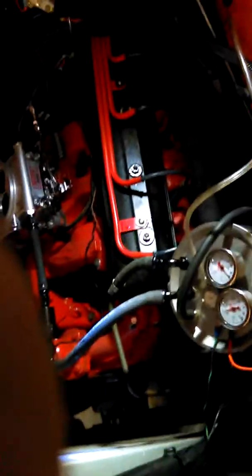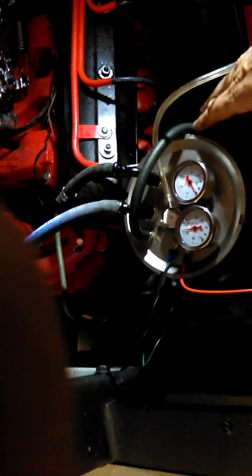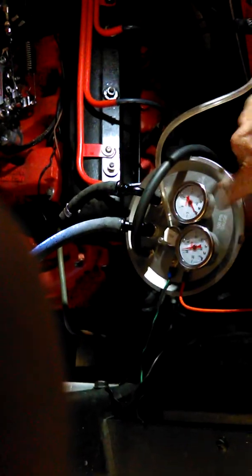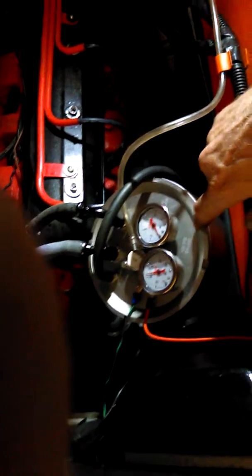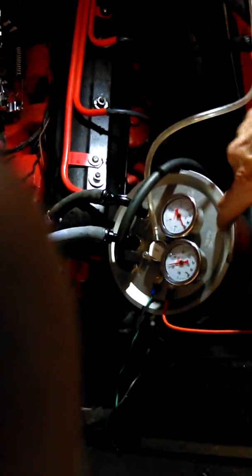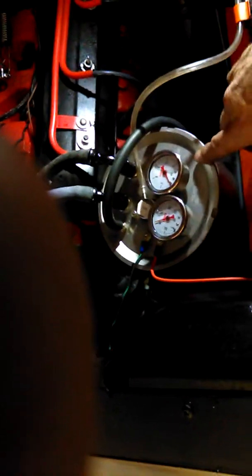The only thing I didn't like was the command center. I realize now why you have to have this hose going back to the tank — because this is a sump. It has a float in it, looks similar to a fuel sending unit, and then it has what appears to be a Holley needle and seat. So it fills up with fuel, gets to a certain height, shuts it off. If it were to stick — which needle and seats do — you need that fuel to go back to the fuel tank. I wish that in the advertisements they would tell you that. Not that I wouldn't have bought it, but they advertise you don't need a return line, and that's kind of a big selling point.